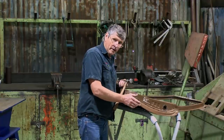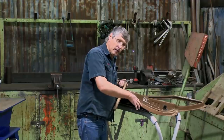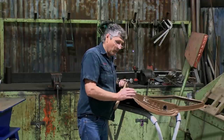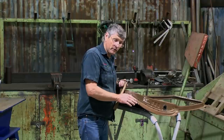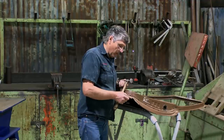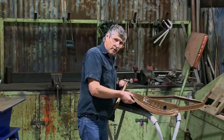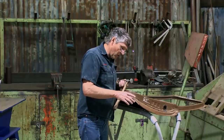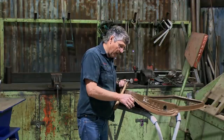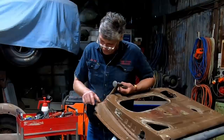If this door was in better condition and we just had a few rust pinholes coming through here, we could shape a piece of metal over the original — that will give us a good enough repair patch that we can perfect once we've roughed it into shape. We can put it on there and make that into a no-fill repair and it would come up beautifully. In this case we've got nothing there, so working to your skill level, making it out of two pieces of metal is going to be easier than making it out of one piece.